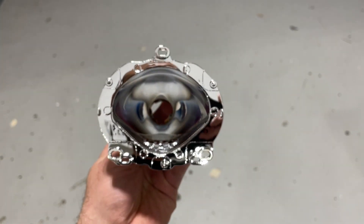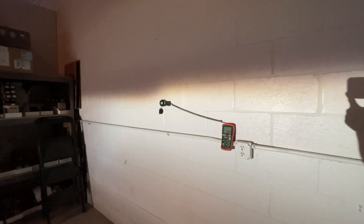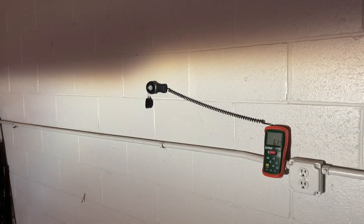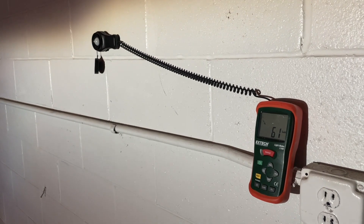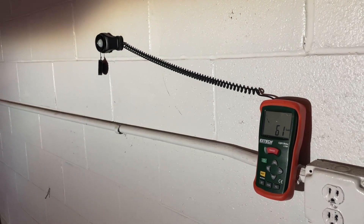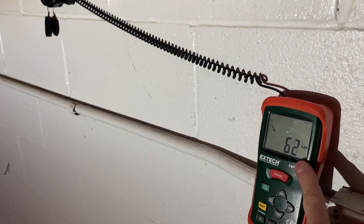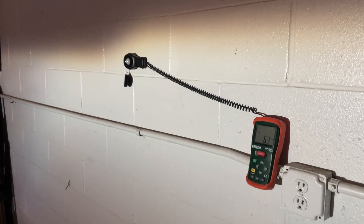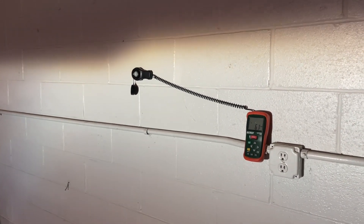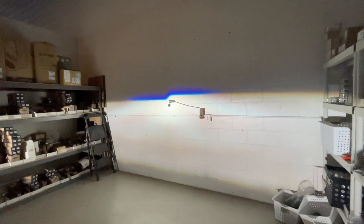That's why the performance is suffering, and you will not have that issue on a full-size unit using a quality bulb. Things are going to change for this Altima. That burned-up projector almost has a brownish output — it's because there's no chrome left. The light is just not emitting properly. The bulbs are probably tired too, but the projector is so far gone it's pretty much handicapped. That's a very weak number at 60 lux — that's literally a halogen fog light level, a very dangerous level.